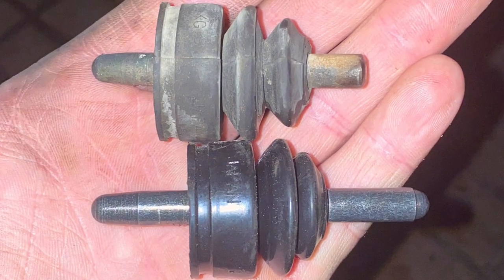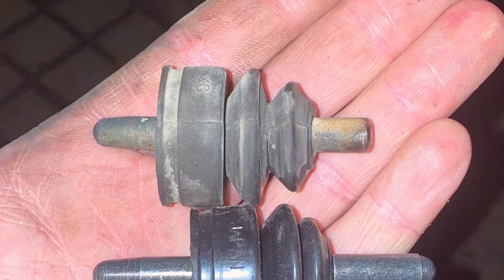So we got the hydraulic line installed. That was a bit of wiggling here and there. It took some time. Our next issue was that while we were trying to bleed the clutch, this slave cylinder pin seemed to have been too long, which took a lot longer to figure out than I thought, until I popped this end cap off, because I thought there might be some adjustment for the pin, which there isn't. And for the old pin, they basically shaved off the top, or shaved off maybe like a centimeter because of the aftermarket clutch. And I guess the fork has a different, more aggressive angle. So with this OEM pin installed, the clutch was basically disengaged the whole time.